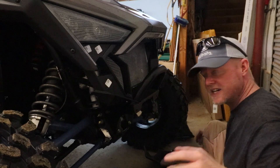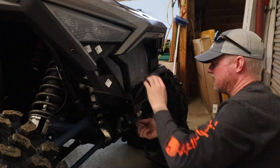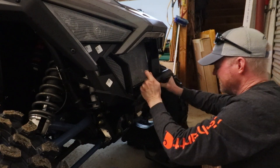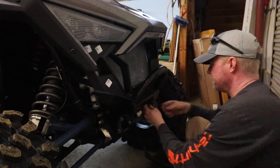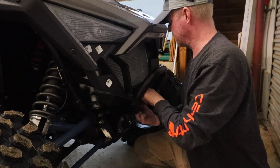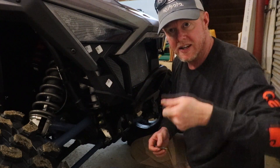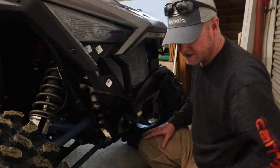This does make it a lot easier if you take the front grill out — I just discovered that. So I'm going to pop these bolts out so I can pull straight out on the bumper hoop. It looks like there's some clips also holding it. For these clips, if you have the plier style clip rather than the pull pin clip, these are recessed and really hard to get to. Let me go see if I can find those.